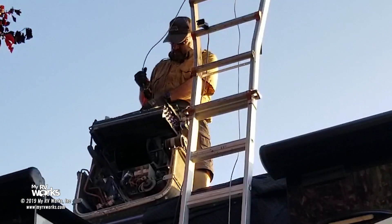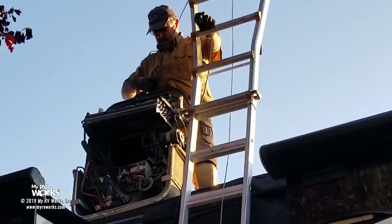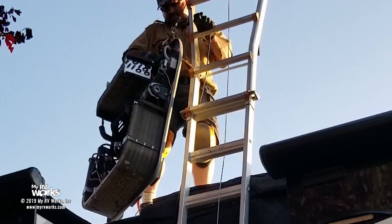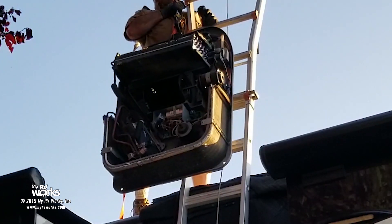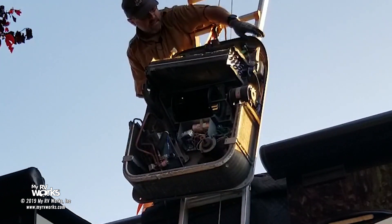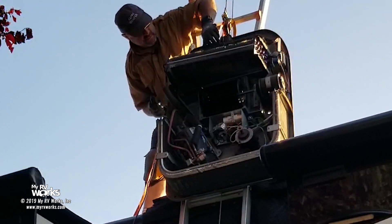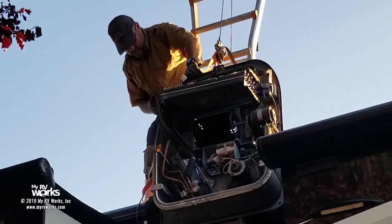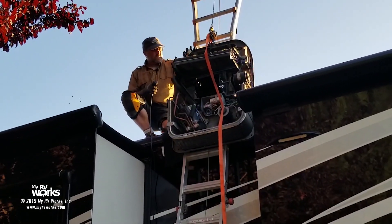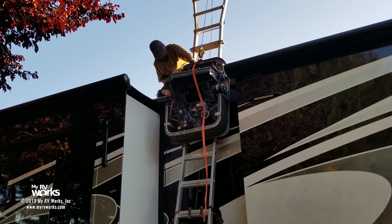Now that I've got my air conditioner attached, we're going to go up. I want to make sure there's enough tension on it. I want to make sure there's nobody below me. I've done this a whole bunch of times and there was one time my strap slipped, so I'm looking at my connector — everything's good. Here's my 12-foot lead, and what I'm going to be doing is going down with this and making sure it doesn't get hung up on any of the rungs on the ladder, which it does have a tendency to do.